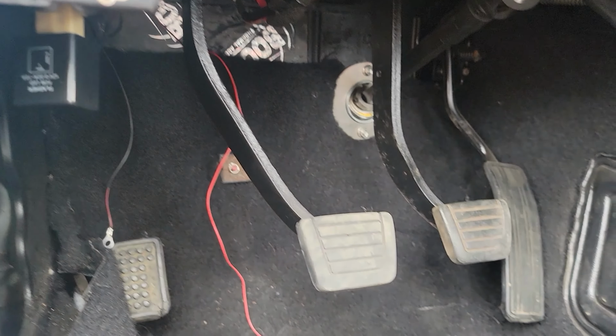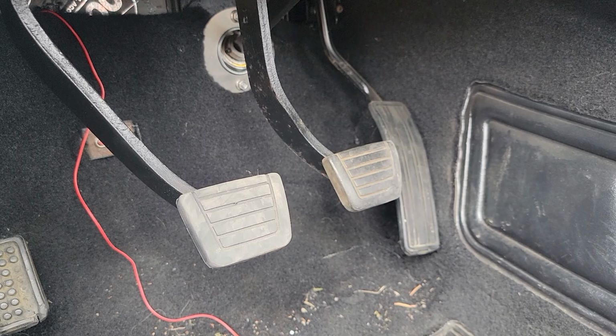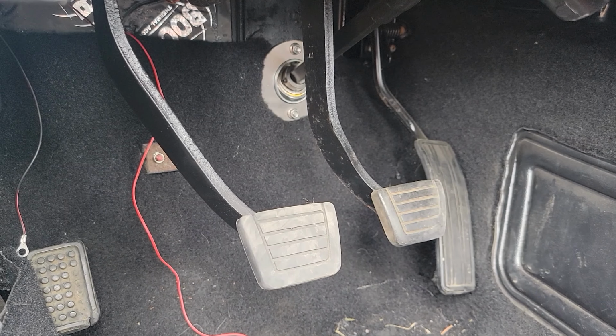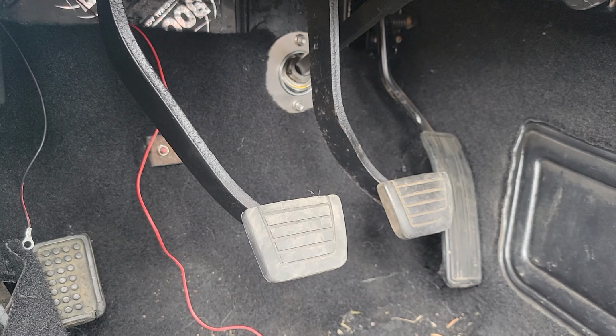And so as soon as Autumn lets off the clutch, it'll deactivate the two-step, and so it should make it a lot easier for her to stage and just hold it at a consistent RPM instead of trying to feather the throttle pedal at a certain spot and watch the tack and watch the tree lights. And so she can just hold it full throttle, and then as soon as she lets off the clutch, it'll go wide open throttle from like 4500 or so when she launches.